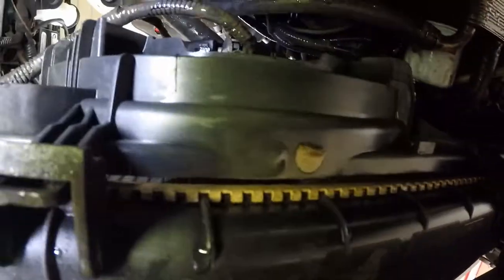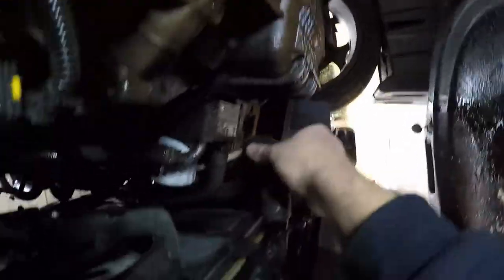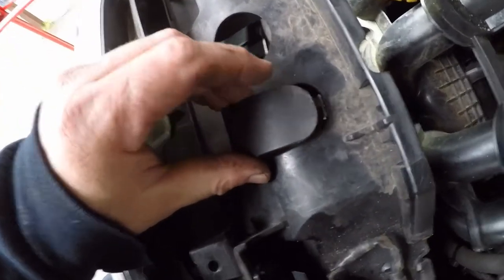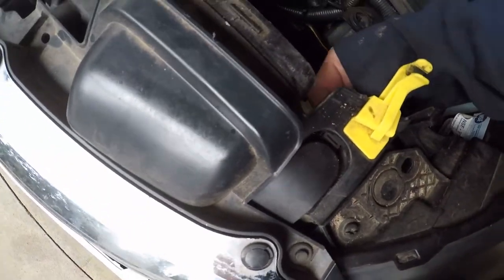This metal piece right here and this right here — pop that radiator, just kind of push that in, and that'll separate the condenser from the radiator. All right, I got the clamp off, so just kind of pull it. This one probably ain't got much in it since it was leaking so bad — straight water. You'll go through here and pop this little piece off. You've got two of them, one here and one here. This one's been wrecked, so this might not be like yours. This goes right here — it's got a little clip, you just push down on it and pop that out.